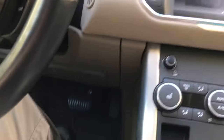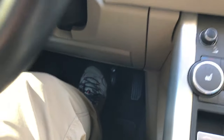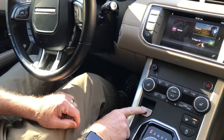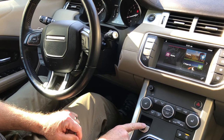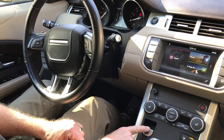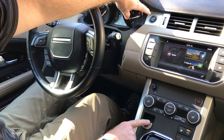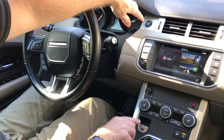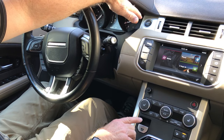The process we're going to go through is I'm going to depress the brake pedal, and then I'm going to press and hold the electric parking brake lever, which releases the parking brake once you've got the brake pedal depressed. Within five seconds of pushing this in, I'm going to shut the engine off and continue to hold this for at least two more seconds. That will then disable the electric parking brake and disengage it until I restart the car.